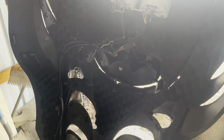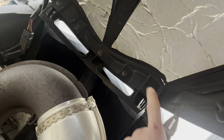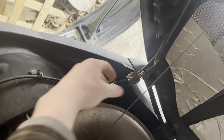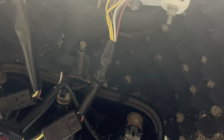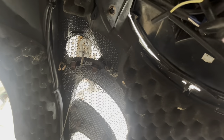I'm going to paint it up nice gloss black and we'll see how it goes. The first step is to remove the hood from the hinges - just leave the hinge on and pull the hood. But first we have to get the wiring harness and the speedometer disconnected. Got the main harness to the hood disconnected. Now all we have to do is remove that speedometer cable, which I'll just unscrew with a pair of pliers - just like so, and it pulls right out.